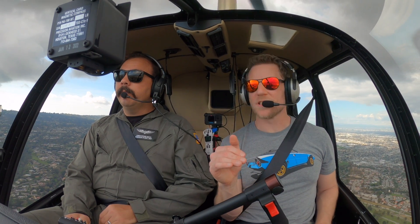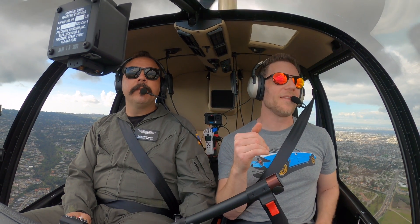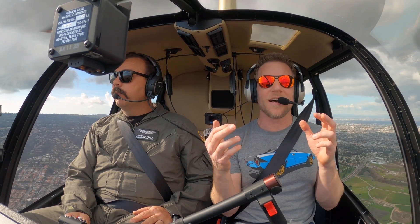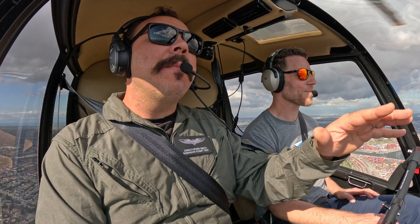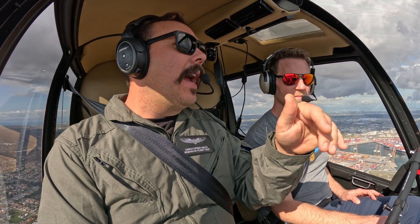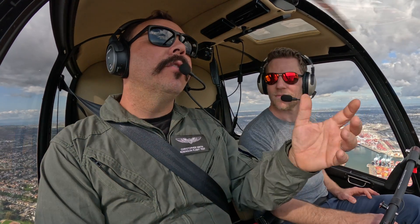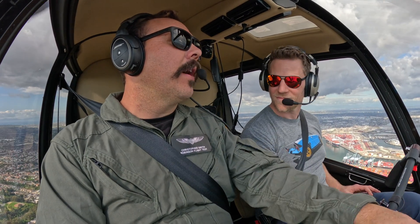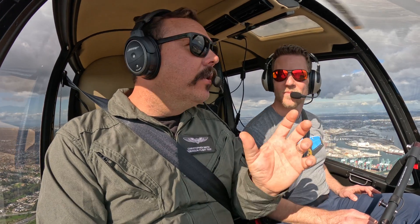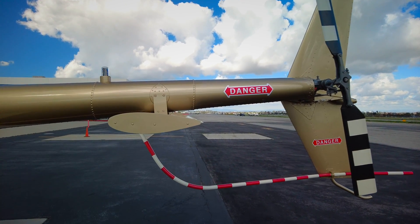I think about it in automotive terms: you shouldn't drive dangerously fast when conditions don't justify it. This might be akin to adding stability control — you have margin and a safety net, but good judgment still dictates that you don't drive like an idiot. Same concept flying in turbulence: if you go so fast that the inertia of the helicopter body wants to keep going one direction while turbulence or bad pilot input changes the rotor system's direction, that leads to low-G and the right roll. The new H-stab reduces the right-roll tendency, which reduces the potential bad behavior of the pilot putting in the wrong correction — which is left cyclic.